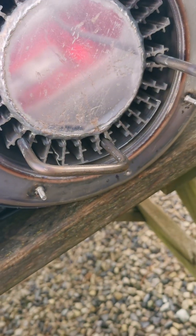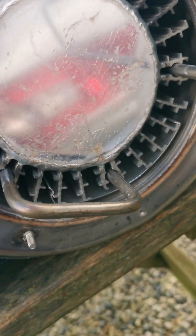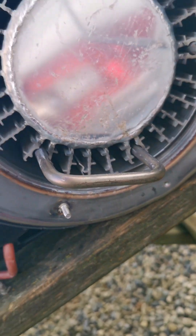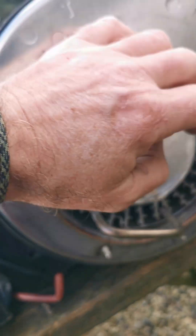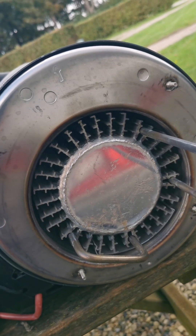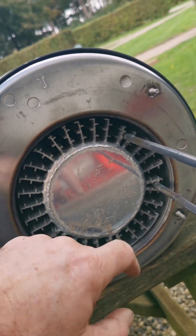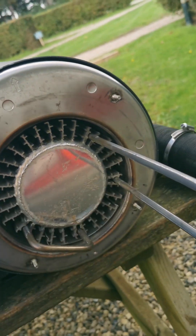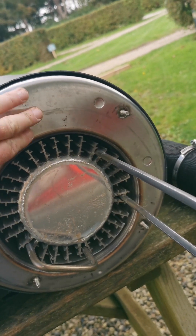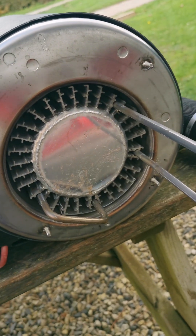This is the back of the boiler. As you can see, these two elements slide into two little grooves in the heating fins. That's the gas chamber in there, and this is the water jacket on the outside. When the gas is running, that heats up and radiates out to the fins. When you're on electric, the elements heat up and radiate out, which is why you also get hot water even when you're running the heating on electric.